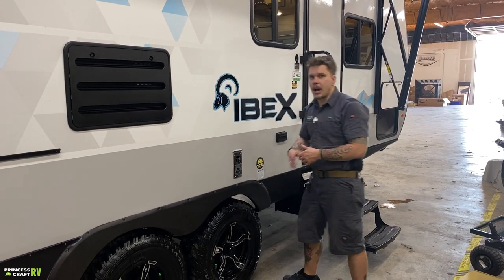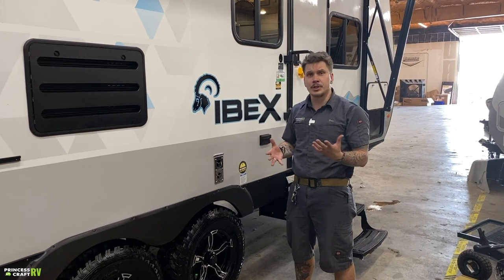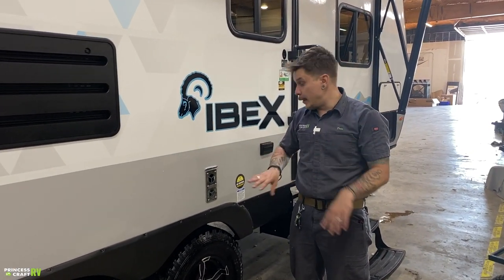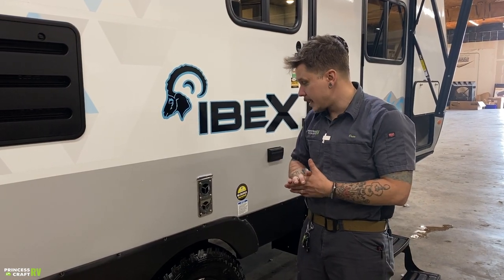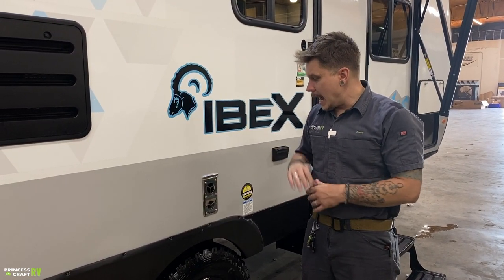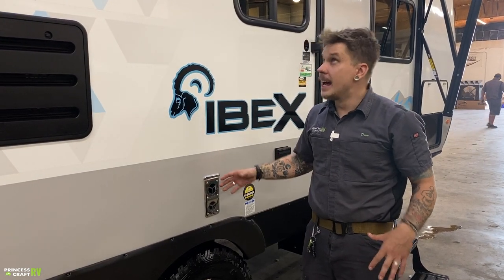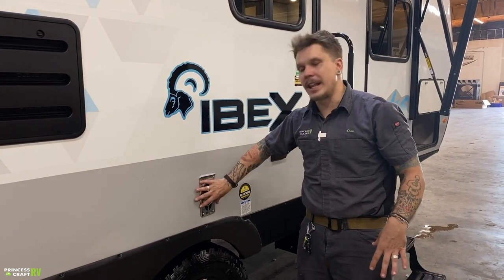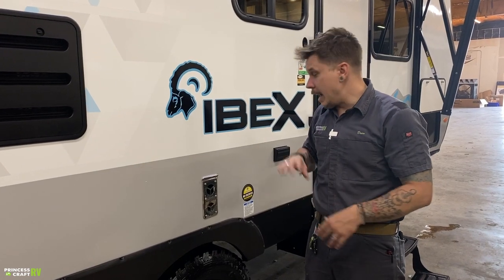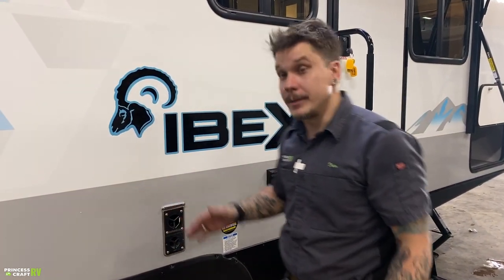Furnace vent here. So kind of like the refrigerator, not something that we would really consider a customer serviceable unit. And it is also very important that we protect it from mud daubers and flying insects by utilizing those screens. But also with this is an exhaust vent. It's very important that we do make sure we let it exhaust. Here in this kind of porch space, I could see someone putting like a lawn chair or something up in front of it. Do make sure that we are not restricting that flow. It does blow very hot air when it is on. It is going to go ahead and melt anything that you put in front of it. So keep that in mind.